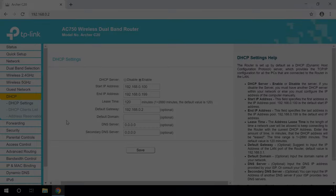To set up this function properly, you should disable the DHCP server for the router which has the WDS bridge configured — that is, for the secondary router. It is also necessary to have its local IP address in the same subnetwork as the primary router. Enter the DHCP menu of the secondary router and disable this function. This is the last step in getting two routers connected by Wi-Fi. Find the right location to place the second router so it falls within the effective range of the main router. Set the desired name for the wireless network and a password.